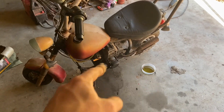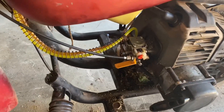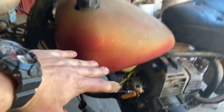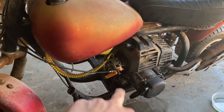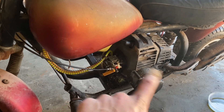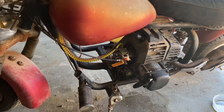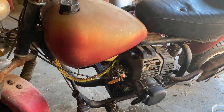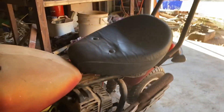So we've got the carburetor back on as you can see. I did discover a problem with it as well - I've only filled the fuel tank up just enough to get it going, as all the fuel leaks down since it has no tap and leaks into the carburetor and into the bowl, so it floods the engine. I only found this out yesterday when I was trying to get it going without the carburetor all fixed.